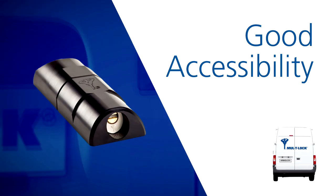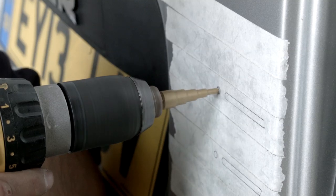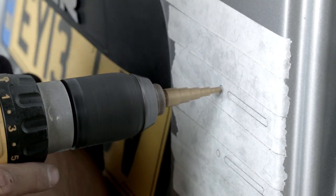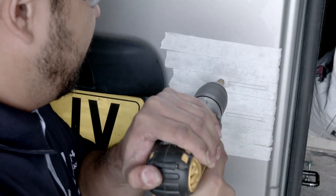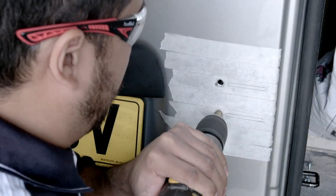How to install the lock onto the fixed door when you have good accessibility. We are now ready to drill into the van door. Using a step cutter in the centre of the two round fixing positions we have marked, we can drill these holes making sure we do not exceed 8mm in diameter for each one. In the absence of a step cutter, we could perform this operation using a series of drill bits.